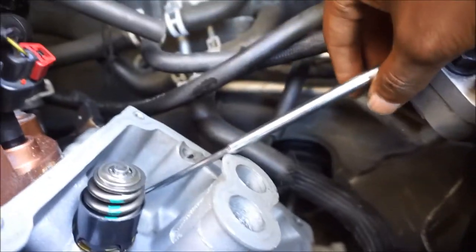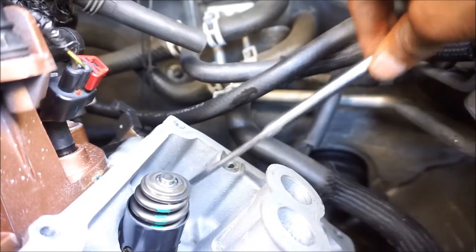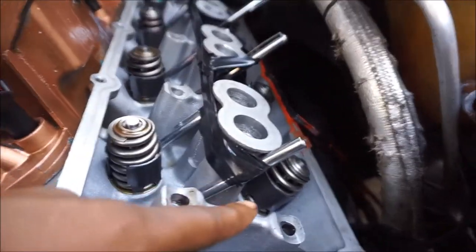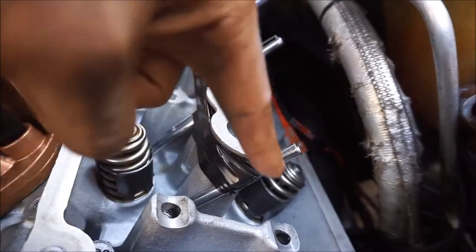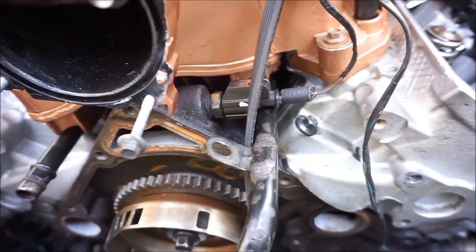And this is why the magnets are needed. Listen. That's the lifter up. That's the lifter on the cam. Alright, so this is the setup to hold the lifters up. I pretty much got each one wrapped around and then wrapped around another one. And then after that, I wrapped it around the whole head on both sides. So I'm hoping this holds. I'm really scared because I do not want it to fall into the block. So let's try and take this cam out really, really carefully. The cam came out. See? Look at that. The method I chose to use is working so far.